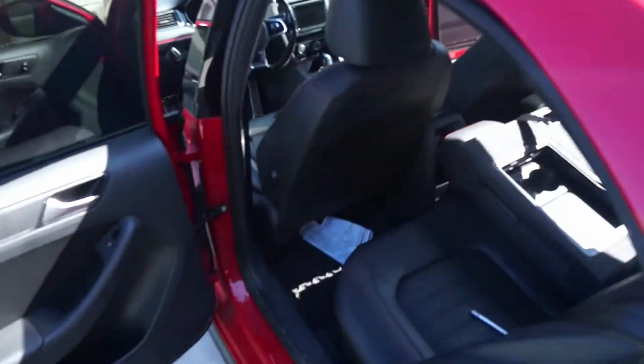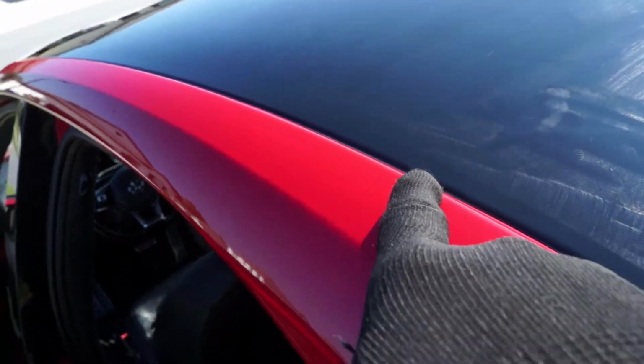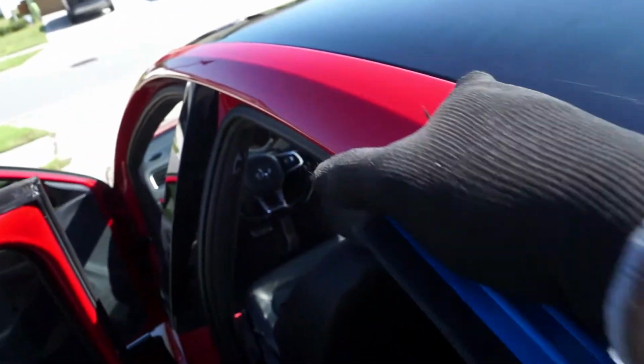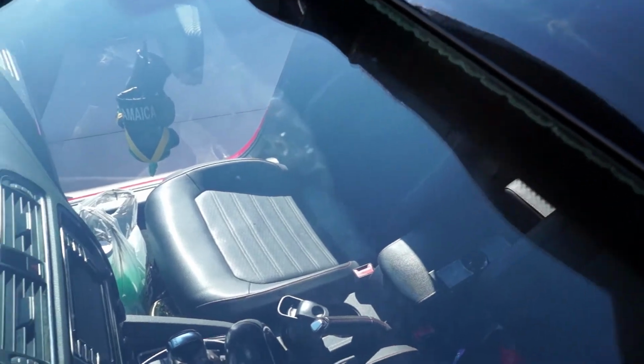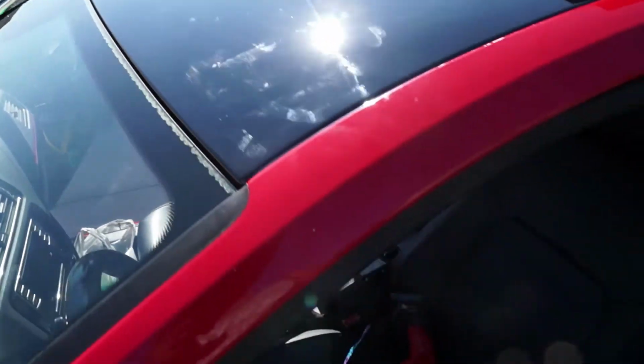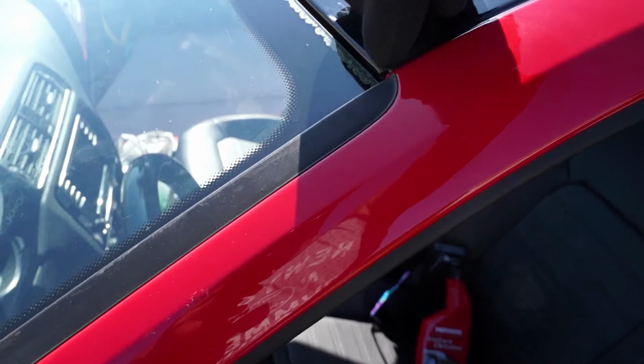So now I'll go around and I'll trim and then tuck in where I need to tuck in. Use a knifeless tape and then post heat, and hopefully we'll have an acceptable outcome. I forgot to pick up the camera, but anyway. Knifeless tape. Line is pretty good. I have heated and wedged the front part up underneath the glass and then cut. So as you can see, the line is pretty good here. I'm happy with it so far.